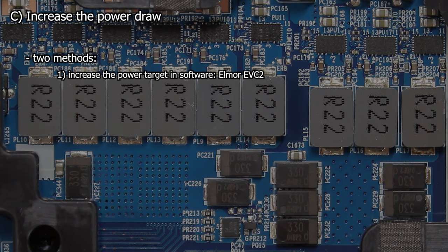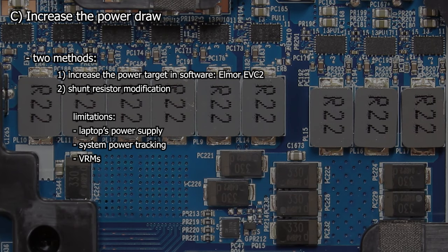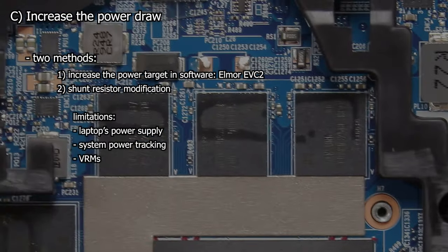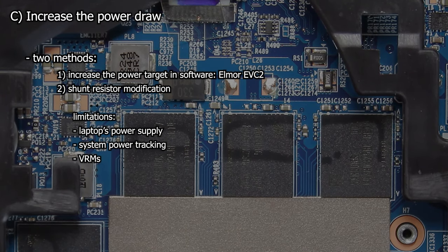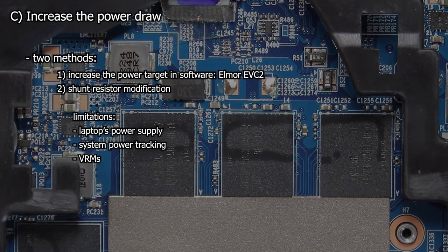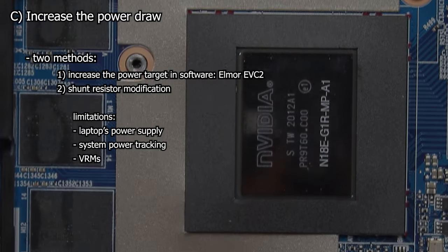The final and permanent solution would be to shunt-mod the laptop's RTX in a comparable way to desktop GPUs. The task itself is not too hard, but we need to pay close attention, as for most desktop GPUs, our power draw is still very limited because of the power supply and probably also because the laptop's EC tracks the total system power draw and shuts down the system if a certain limit is exceeded. I hope the 140W power limit will be low enough to not run into any problems, but I think the 125W power limit will most likely perform just fine.